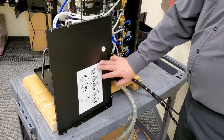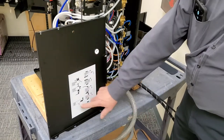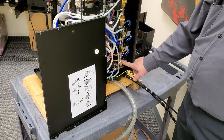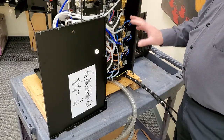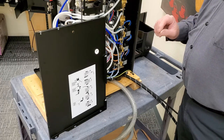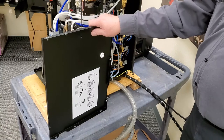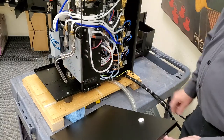On this side we have access to all of our solenoid valves and our pump. On the inside of the panel there is a legend telling you which valve is which. We've got a brew valve down here, our auto level fill valve right here, hot water valve, steam valves, etc. A couple of these valves aren't utilized because the one-step uses some of these valves and this is just a two-step machine with auto steam — in this case the easy cream.